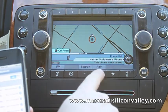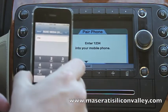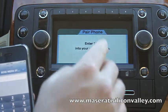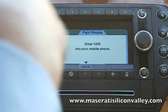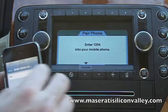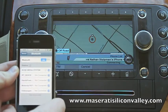So I will say pair, the soft key says pair, and it says to enter 1234 on your mobile phone, and my phone also is prompting me at the same time to put in a PIN. So this is important. You want it to prompt you at the system and prompt you at the phone at the same time. If you just do it from your phone and it asks you for a code and you put in the code, sometimes it won't work. So you want it to prompt you from the car itself. So you want to put in 1, 2, 3, 4, hit pair.